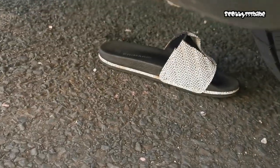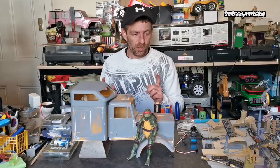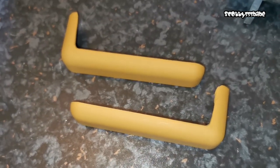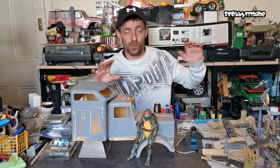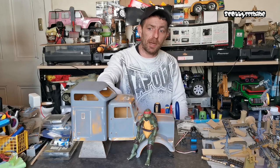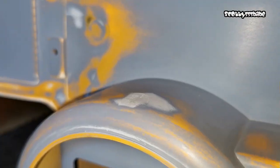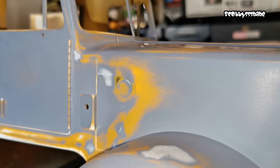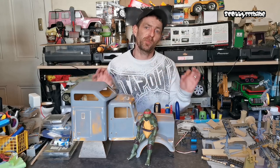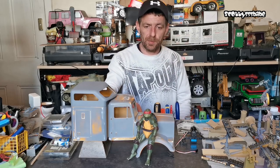Six and a half hours later — these are the little sleeper side skirt extensions. In the last photo you see the truck was all in the yellow prime and everything; I have since flattened that back down, primed it, flattened it again. I am just trying to pick out any slight blemish or marks or indentations — pinpricks in the filler — trying to get this totally 100% smooth.